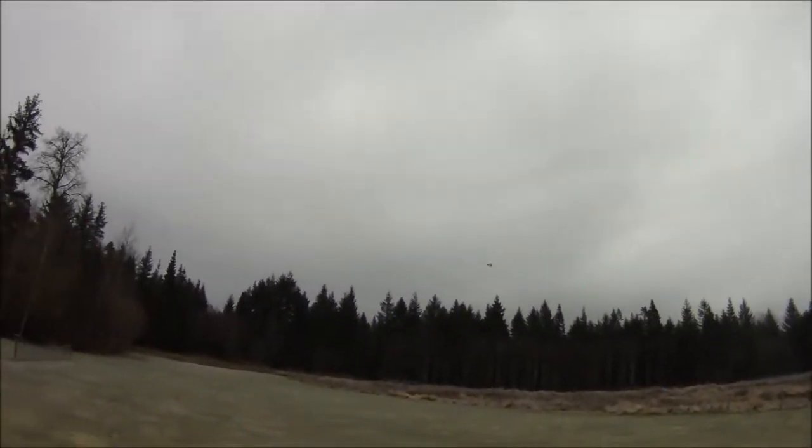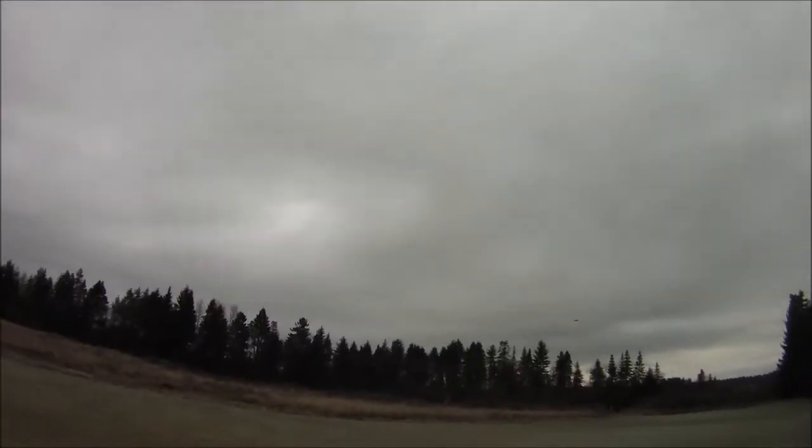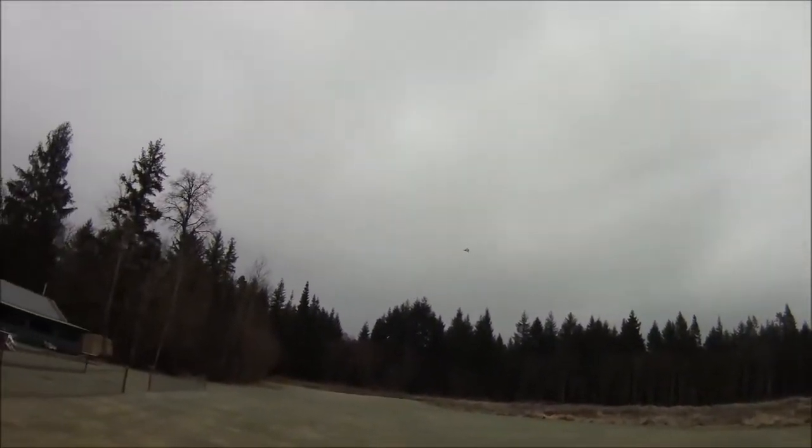So on the bench, about 32.4 amps on a 3S, 28.6 ounces of thrust. Compared to the RC timer motor, it was a bit more efficient at 29 amps but one ounce less thrust — 27.6 ounces of thrust.